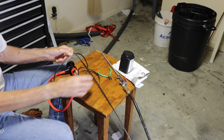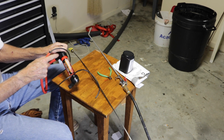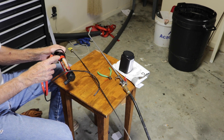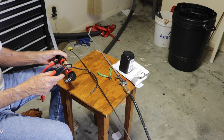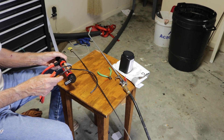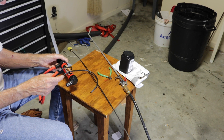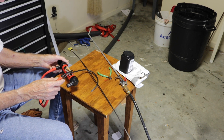That's really the only significance of matching the tube length. The pump goes in from the top, it sucks from the top, and then it pushes out here. So what I'll do is just pump a little transmission oil through. I don't know if I'll have to top it back off or not — it's not going to take a whole lot to pull that sample, but I do want to purge some through there.